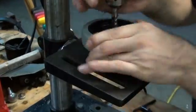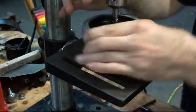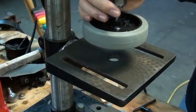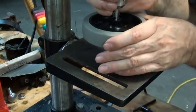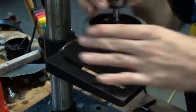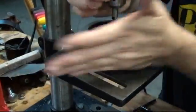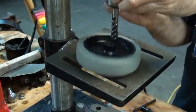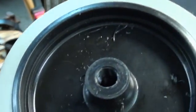You want to go all the way through this bore. The tap is just poking out on the bottom, so the entire bore is threaded all the way through. Now just go the other way to un-thread the wheel and the wheel comes off. Take a look in the bore — you can see it is threaded.